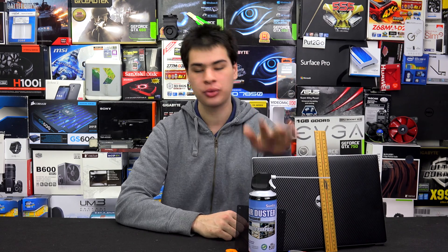Turn the computer over, power it up, make sure everything works, and you are good to go. Adding a fan filter to your computer will not only keep all the dust out, but it will keep your temperatures down and allow your computer to run cooler and better. If you're in a situation like the Dell XPS 15 where it draws air from the bottom, you'll find this a really helpful mod. Let me know down below if you have any questions or problems whilst doing this and I'll be happy to help. Thanks for watching and I'll see you all in the next one.